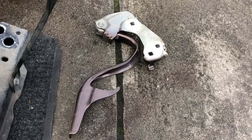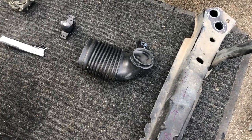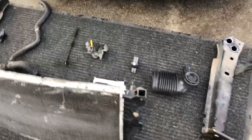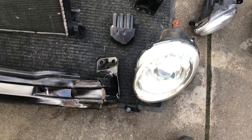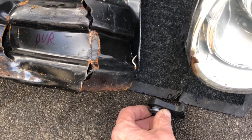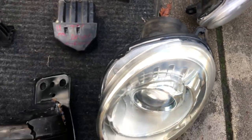There are the hood hinges — you can see they got bent a little bit, so they had to be replaced. This air intake hose that goes into the air cleaner assembly was bent over so badly it wouldn't allow air to get in. And I went ahead and replaced the hood latch. You can see the headlights — they still work, but unfortunately the tabs are broken off. This is the adjustment tab — you move that little nut there to get your headlight adjustment side to side, and you have the up-and-down adjustment using a 6mm hex key.